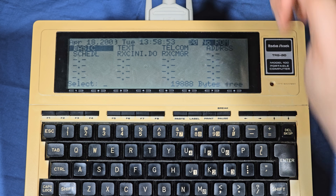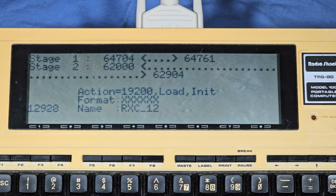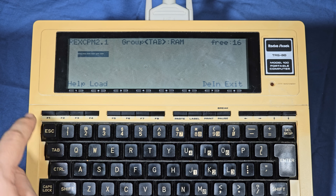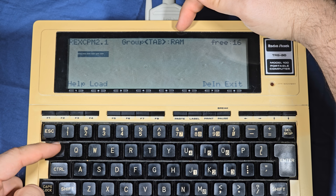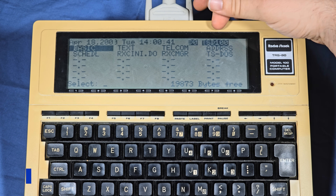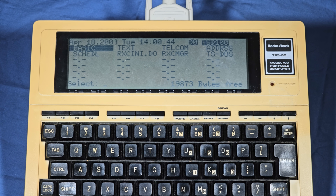With the REX portion ready, we can now load a proper Tandy portable disk drive client on the Model 100. The bootstrap script is a brute force client and the text load method won't allow us to copy binary applications, so we need a full client to continue. Run the REX manager program from the main menu or press the new shortcut Ctrl+A to configure the REX. From here we will need to switch from the RAM mode to the ROM mode by pressing Tab. We can now press F2 to load an option ROM from the Tandy portable disk drive server. We're going to load tsd100, which is the Tandy portable disk drive client. After the file is loaded in, press enter on it and accept to set it as the active ROM. From the main menu you will now have tsd100 as a program. We're now finally ready to copy over and install CP/M.